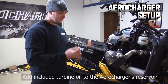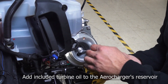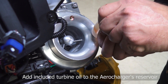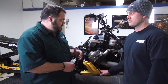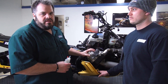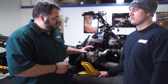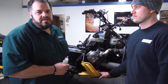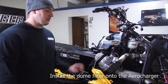Next step is to put the oil in the turbo. You're going to have to cut off the little nipple here. You'll notice there are two brass nuts — one has a hole, it's a vent, and the other one is where you put your oil in. You will put both of the bottles in there — they come in the kit, two full bottles. Put a little Loctite on there and reinstall the plug. We get a lot of questions about how often to change the oil. The truth is it's a lost oil system — you never need to change it. As a general rule, check the oil once a year. We want to maintain the oil level somewhere between half an inch and one inch. Sometimes this cap can be a little tight, so you might need to put a drop of oil around there to slide it on, but it should be a nice snug fit.